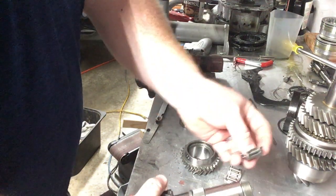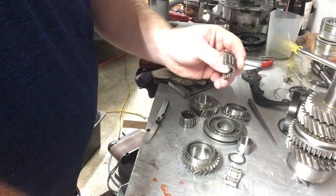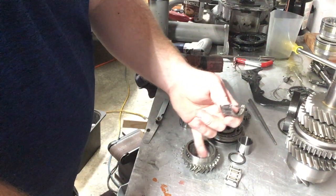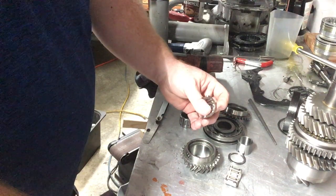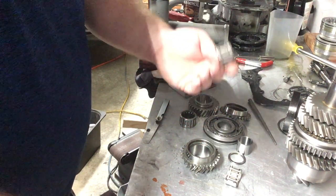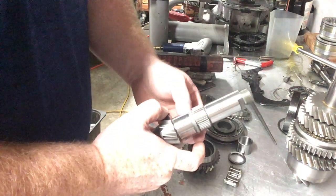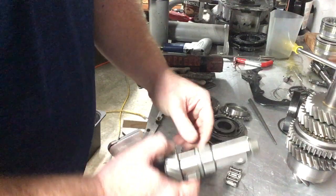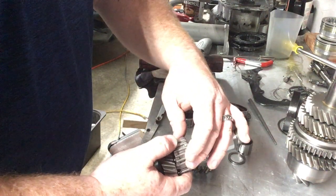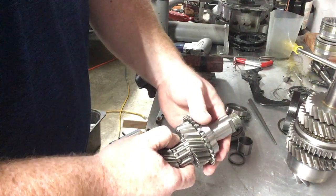Because of the shoulder here, you can't obviously drop a bearing on. You do have to be careful when you order your bearings to pay attention to the bearing IDs. These are the larger 40mm bores, so the rollers are quite a bit bigger than stock. You're going to put your two-piece bearing on — it's going to be a little fiddle-faddle with that.